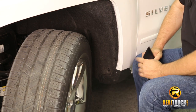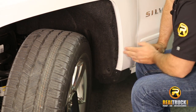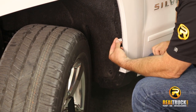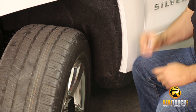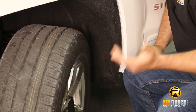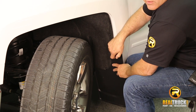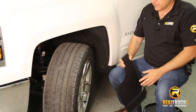On this particular vehicle, we're going to have to do something just a little bit different. If your vehicle has an opening on the inside and your inner fender lip is flat, you would drill a quarter-inch hole for your top hole, then take the provided clips and slide those over from the inside across that hole, and use the provided screws to hold it on. Ours does not have that flat surface, so we're just going to attach it down at the bottom, drill a pilot hole, and use the provided screws to put it on at the top — and it'll work perfectly that way.